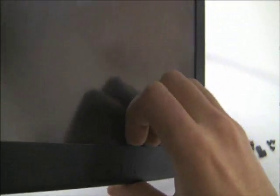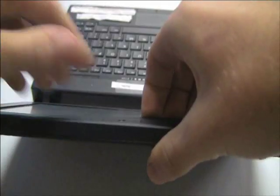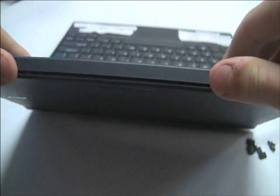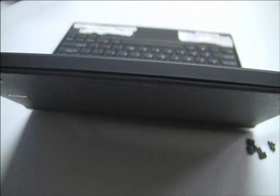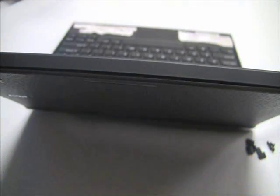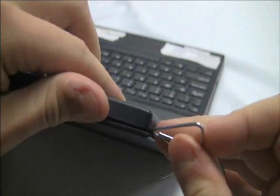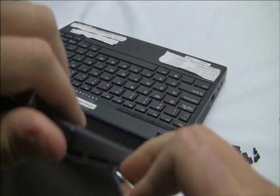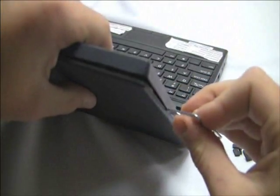Kind of get your fingers under there, lift that top of the bezel up and pry up. Just put your thumbs on the back plate and pull it up, pull the bezel up. The clips on the bezel to the back plate pull out on the edges and get pulled outward. So once you get that, you can grab a paper clip and start going around and prying those off.